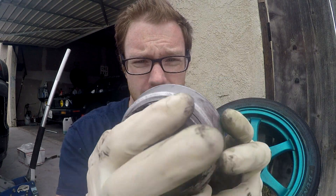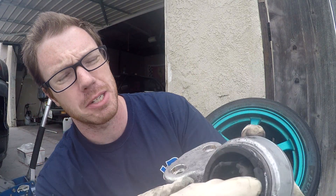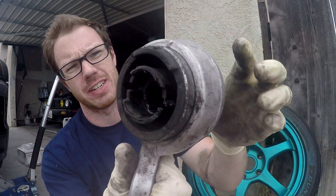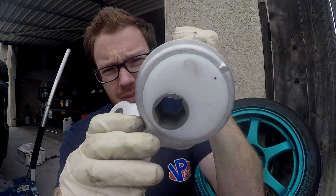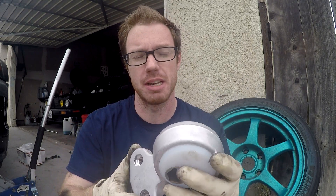Okay so we have the driver's side front control arm bushing out of the car. I wanted to show you the difference between the stock bushings and the Condor Speed Delrin offset bushings. OEM versus Condor Speed — you can see they're both OEM carriers. The distinction obviously is in the bushing type. The OEM bushing is a voided rubber design — there are huge gaps where it's just not solid at all, and that allows for all that squishiness and deflection. I can actually move that whole thing in there by hand, let alone the weight of the car when you're steering around corners. The Condor Speed is completely solid though — I can't move this, it's not possible. That's what's going to give us that increased front-end rigidity and better steering feel.